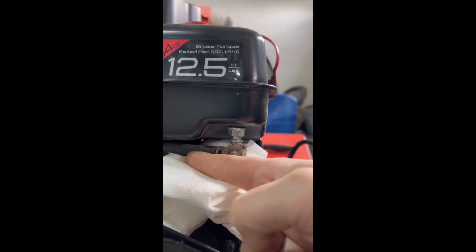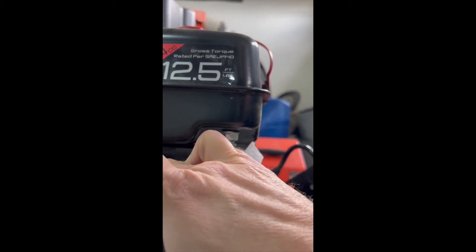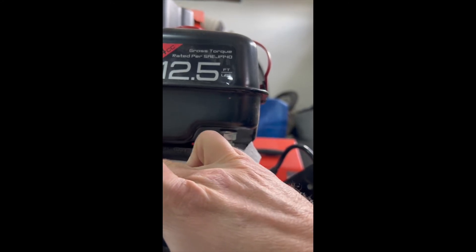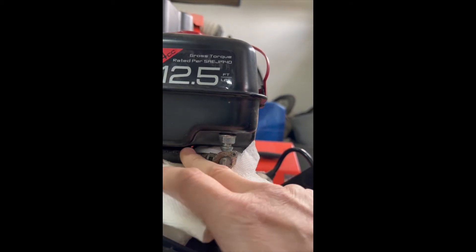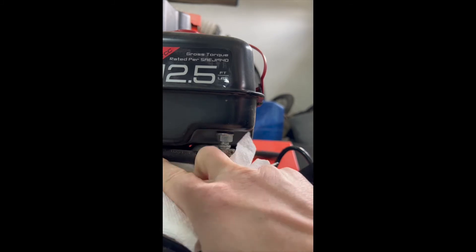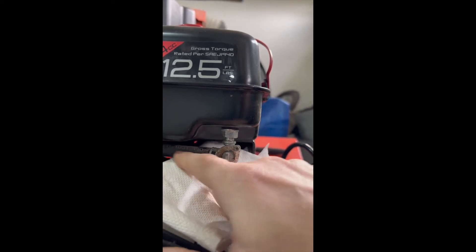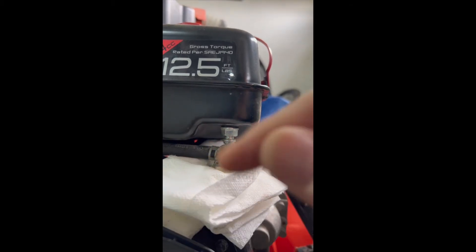Then you should be able to pull the whole tube off. I'm making a special note here: if this unit is older, like any other fuel line — if it's factory or standard and old — you want to inspect it for any cracks, leaks, or anything like that. A lot of times when these are close to heat and old, on a unit that might be 5, 10, or 15 years old, you'll want to replace it with an appropriate fuel line replacement. If this looks good, I'll leave that up to you to decide if you just put it right back on the shutoff valve.